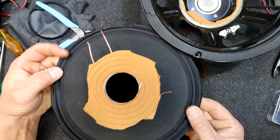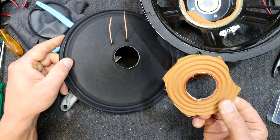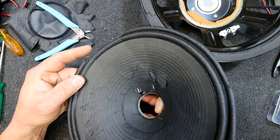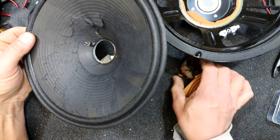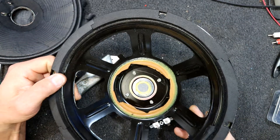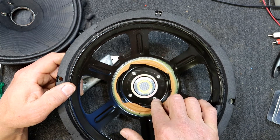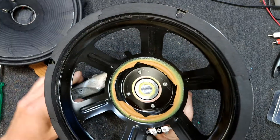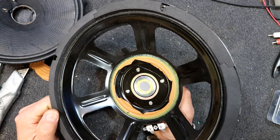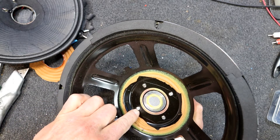So basically you've got the cone with the outer foamy bit that often fails on speakers, then this lower bit just glued onto the bottom of the paper part. You have two flexible wires that go through and are soldered to the voice coil itself. Other than that you've got the magnet — this one's been pushed in and then hit by something like a big cold chisel, some machine stamping those little posts that stick out, to cut into them and make it stay there. It's probably glued as well — I can see some glue has actually come out around it.